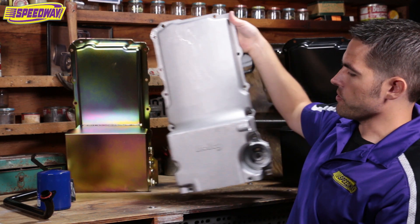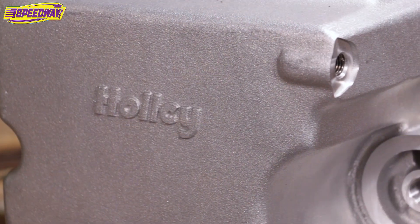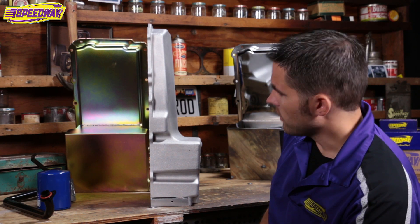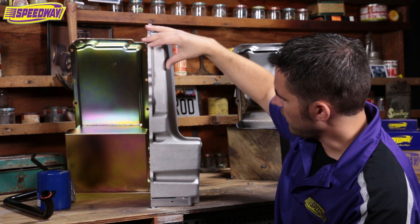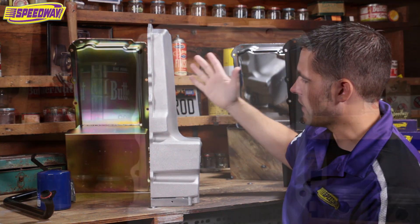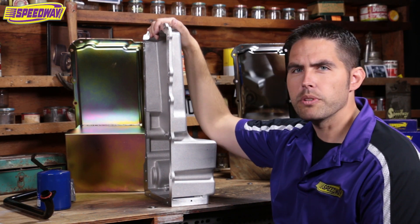This is probably one of the more popular pans on the market. It's similar to the F-body pan — it's from Holley. It's an aluminum pan, and here at the sump it measures five and five-eighths inches. So we're already at least two and a half inches shorter than a stock GM truck pan, which brings you up toward where your cross member would be. The sump at the front is about two and a quarter inches tall from the lip to the bottom, and from there to the front of the motor is about 14 inches. I have this on my Impala and it is literally flush with the front cross member. Great pan overall, and it comes with the pickup and hardware — pretty much all you need to get started.